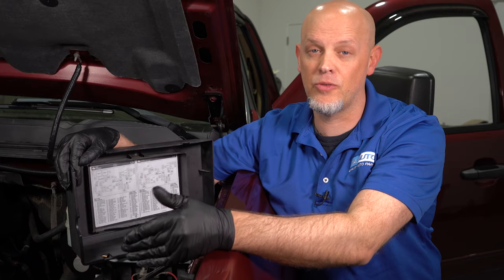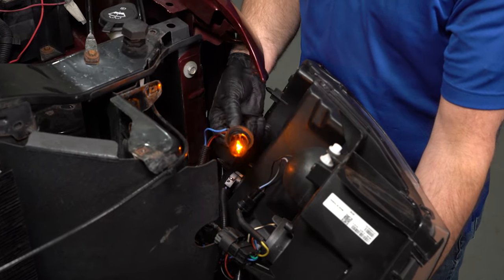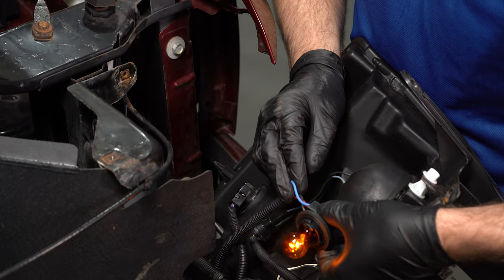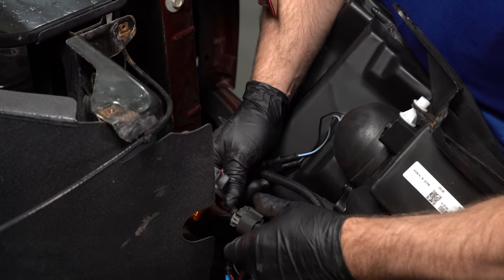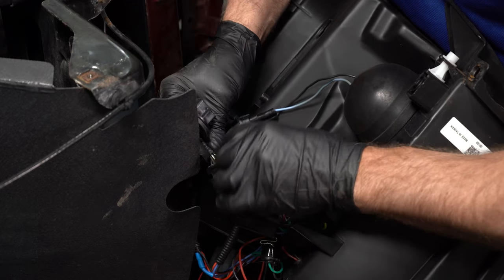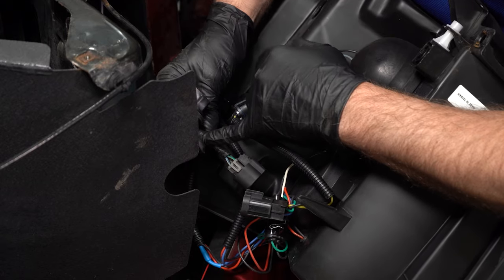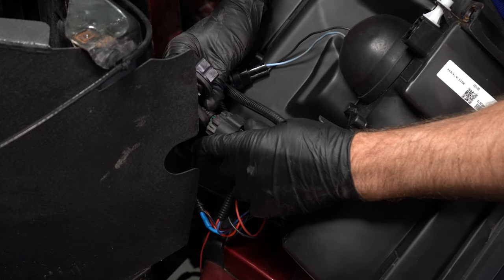So we're going to have to go further down the road, closer to where the blinker or turn signals are, and we can pull the light out. I do have the turn signal on and we can see this is going to be the bulb where we're going to tap in the wire. For this vehicle, it's going to be this blue wire right here. We can follow it back to the connector. If we disconnect the connector, the blue wire is right there — that would also be the blue and white wire right here. It's a little nicer if we just tap into the harness for the light assembly itself.